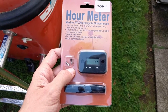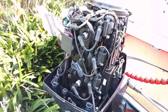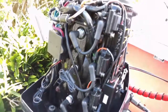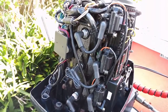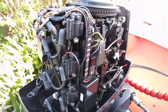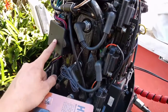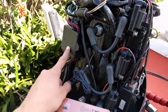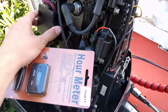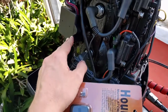So I will go and look on the outboard, as you can see here, and I need to find a sensible place to put this, which will be reasonably dry — completely dry — reasonably free of vibration and reasonably free of heat. I had a bit of a look around on this outboard before and identified that this box here, which has got some internal wiring inside of it, looks like a great candidate to wire it on. It's reasonably flush and reasonably solidly put there, but because it's plastic, it's got a bit of vibration insulation just by default.